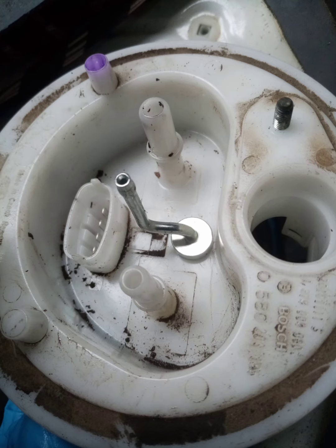We need to make sure before we drill the hole in the sender unit for the metal pipe that we have a tissue underneath so that no debris from the plastic gets into the fuel system. Using a 3mm drill bit, drill a pilot hole followed by an 8mm drill bit which will allow the metal pipe to be fitted. Place the metal pipe into the 8mm hole and on the underside, using the washer and 13mm nuts supplied, tighten it up into the position as shown in the picture.